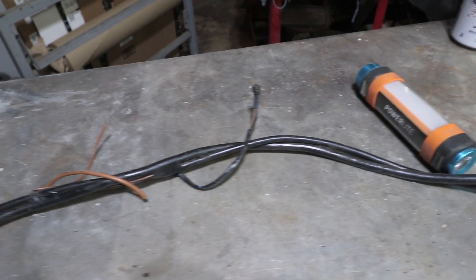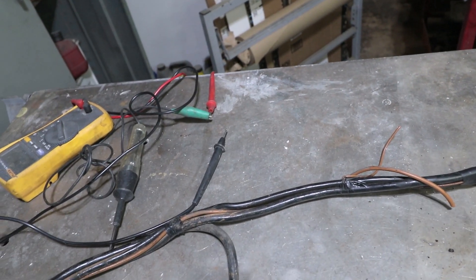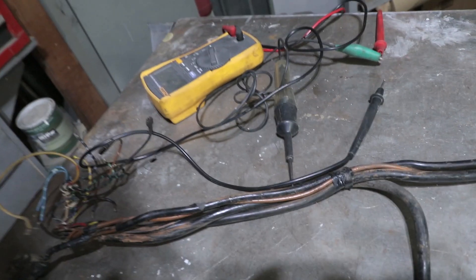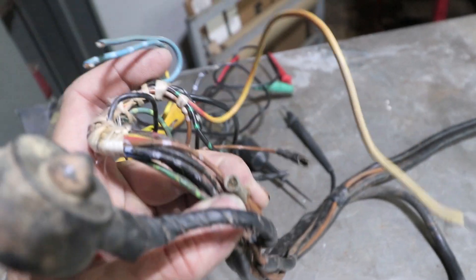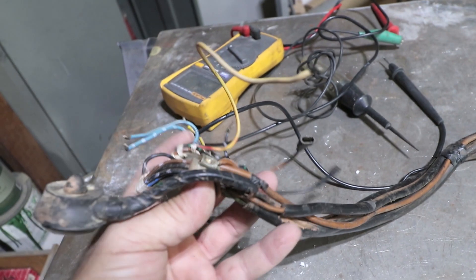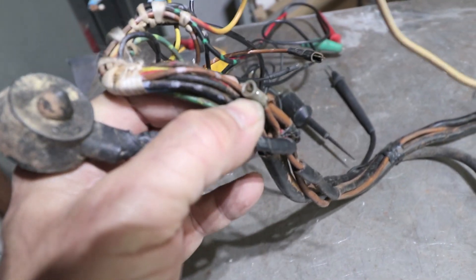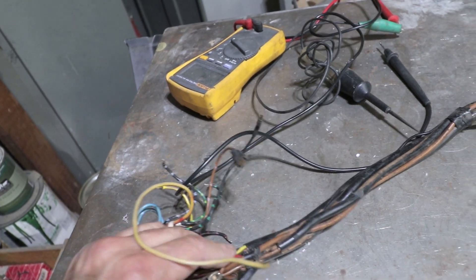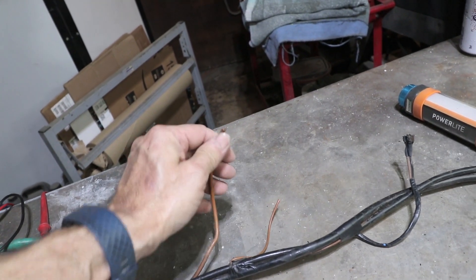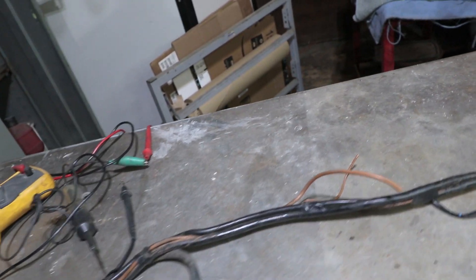Here's what we found so far. This is some pretty heavy sheathing covering some pretty heavy gauge wires, heavy grounds. Right here is where all the grounds connect internally to the harness — this was covered up in tape. That does not look like a connector that's been cut; that's just a splice to put all the grounds in one place. And this wire here is clearly cut — this is the one that probably goes to the body, so that'll have to be repaired.